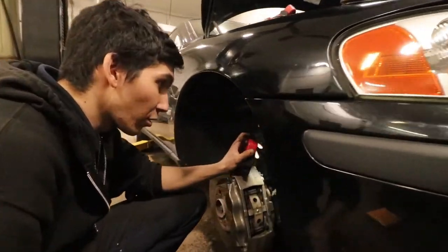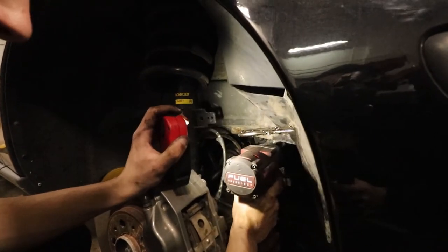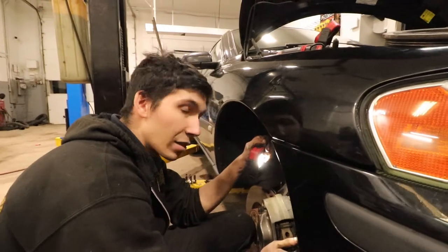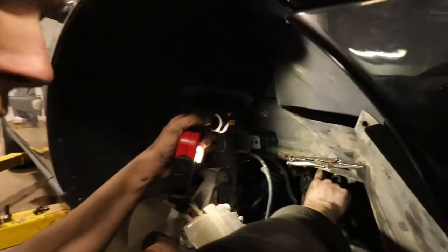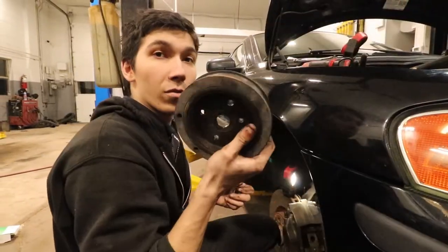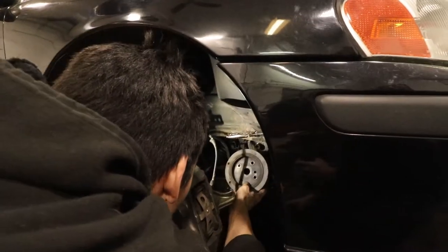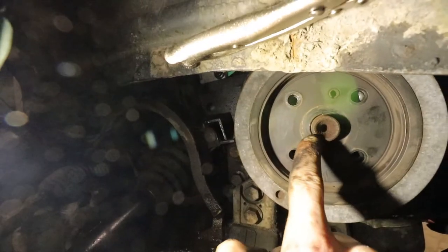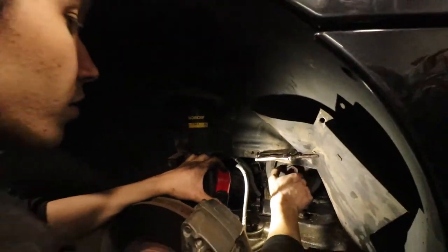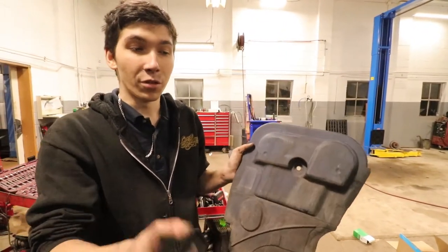Now just put everything back together and you're done. Take off the nut we put on just to spin the engine over — this impact gun should handle it since it wasn't very tight. If you're worried about it spinning, put the bolts in and use a screwdriver or pry bar to hold it. Now we have the balancer to put on — it came from the spare engine but it looked better. There's one dowel that sticks out, so line the dowel up with the hole, then put your nut on and tighten it.